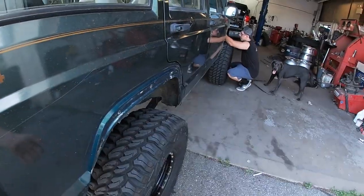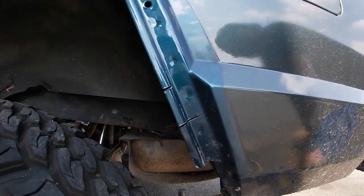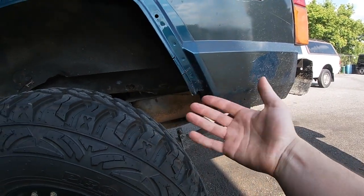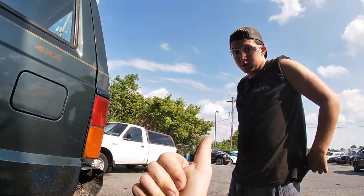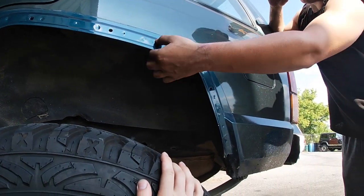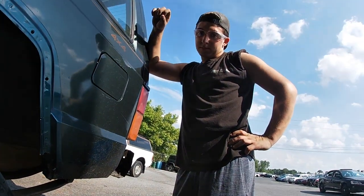The back doesn't need done, but if we feel like doing it we might. It's just some notches and hammering it up into the wheel well - cutting a straight line across and hitting it down. It's basically cutting and folding. On the rear fenders there's a pinch weld - that's what all these little dots on the fender are. If you cut this off, the two pieces of metal separate, so that's why you have to do the fold here. Knowledge of the day.